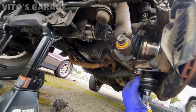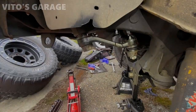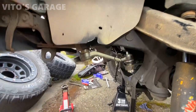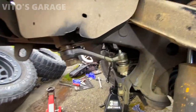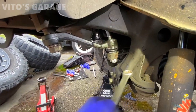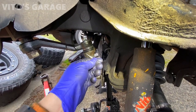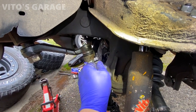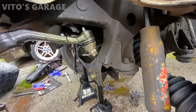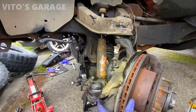Control arm is currently out because I'll be changing those bushings - I'm gonna be rebuilding both of them. I somewhat got the pitman arm as much as I could - didn't want to pound too much on it but it's holding up, it's not going anywhere. Now I'm tightening this 22 millimeter nut and all these joints are gonna get greased up at the end. The cotter pin hole is really too low - I can fit it in there but it's questionable unless I kind of wrap it around.